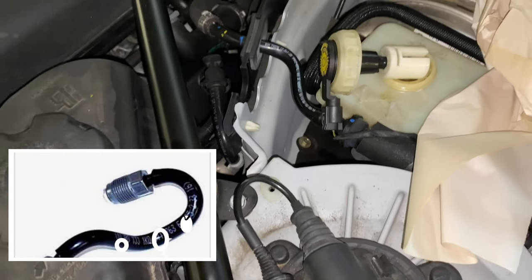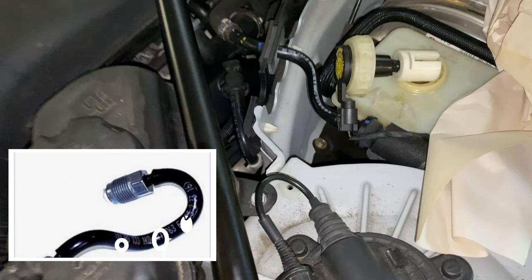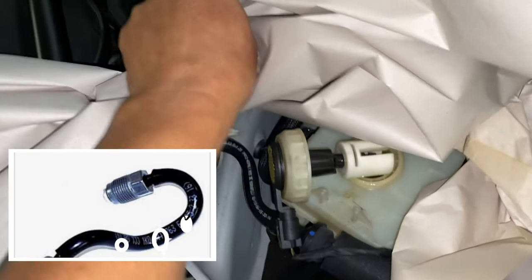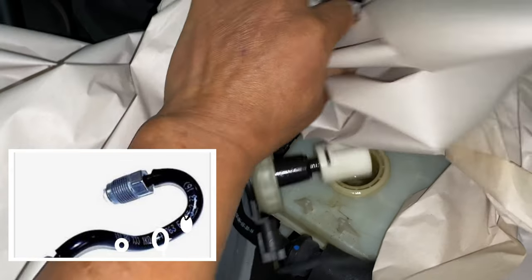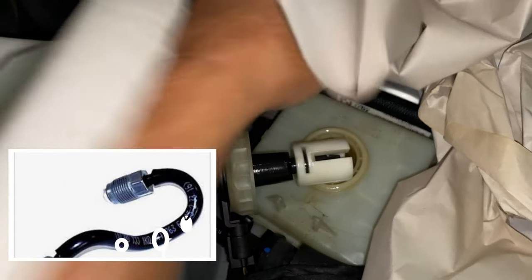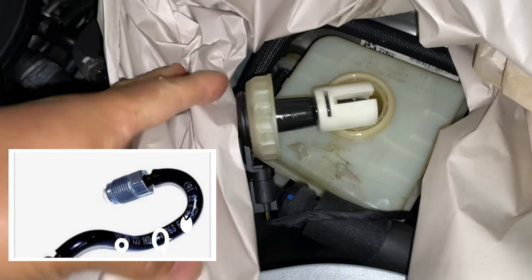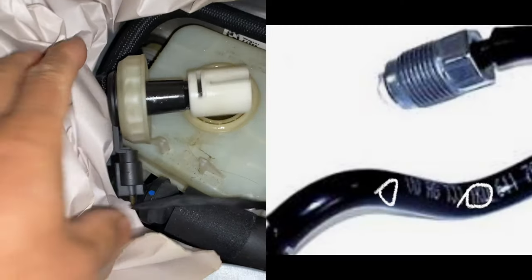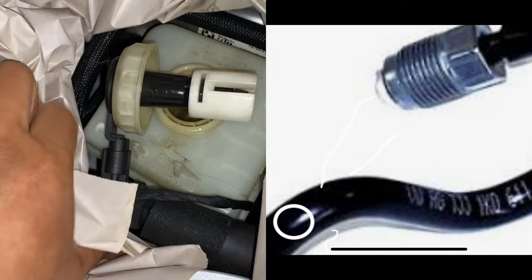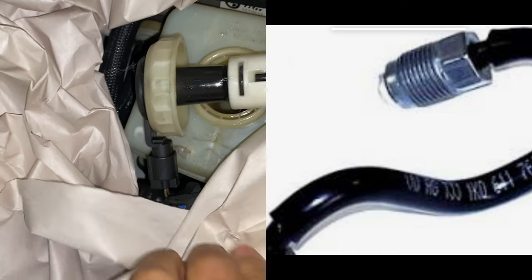How does air get into the brake fluid? When brake pads or brake drums are worn, or brake service is performed, such as replacing the brake pad or drum or reconnecting the brake pipe, this can result in air intrusion. The so-called bleeding is the process of replacing the brake fluid containing air with fresh, pure brake fluid without air.